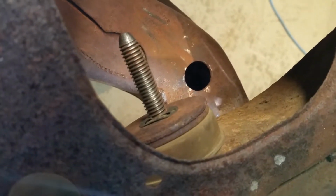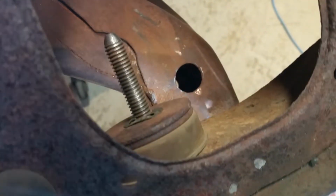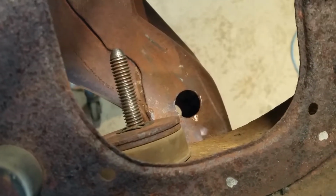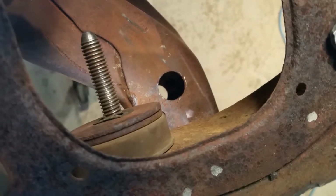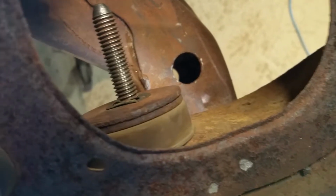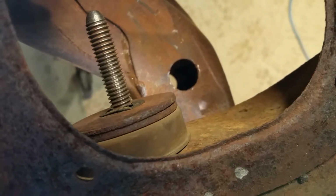So they pull it off the rack, and it's already got the biscuit in it, and it's already got 2 of the thicker washers and a clip to keep it, which is similar to something they would have used on the rear brake drums in this era, if you happen to have an original car. So this is what it looks like. This is exactly what the workers had when they picked it off and put it on the front of the subframe. All I had to do is cock it at an angle and pull up on it, drop the nut in there, and wing it up in there, one on each side. So that's how that looked.